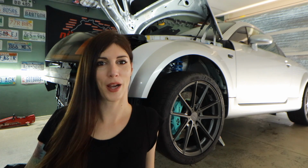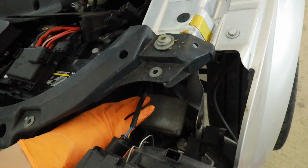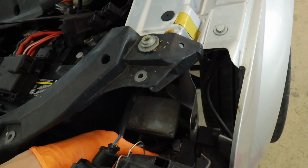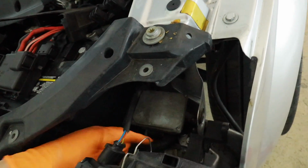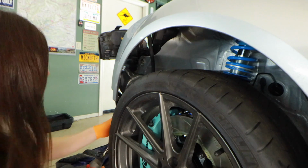Of course the top bracket is inaccessible and you have to remove other stuff to get to the hardware. So the ballast box for the HIDs is mounted above the bracket for the intercooler. So you have to remove this, but this is mounted from the bottom, so you have to remove it from the bottom to get to this, then to remove that from the top. I love working on Audis. Said no mechanic ever.